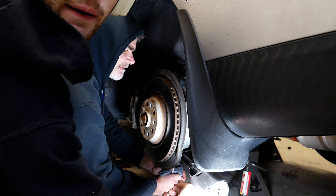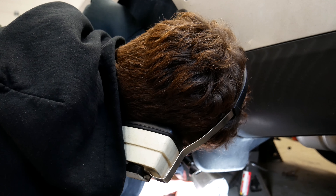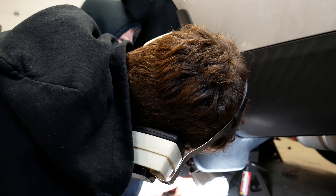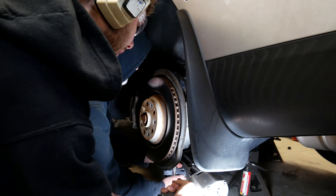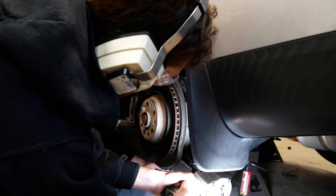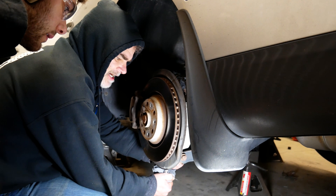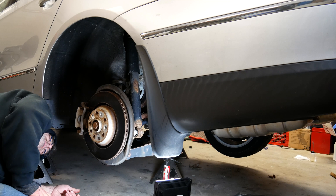I had some help to hold the nut and I used an impact gun to remove it. This can also be done with two wrenches or a wrench and a breaker bar if you're feeling pretty strong. It is very important to make sure that you only remove the nut at this point and that you're not backing the bolt out. You could also put a jack under it before you even start removing the nut to be extra safe, but it does tend to get in the way while you're doing this.